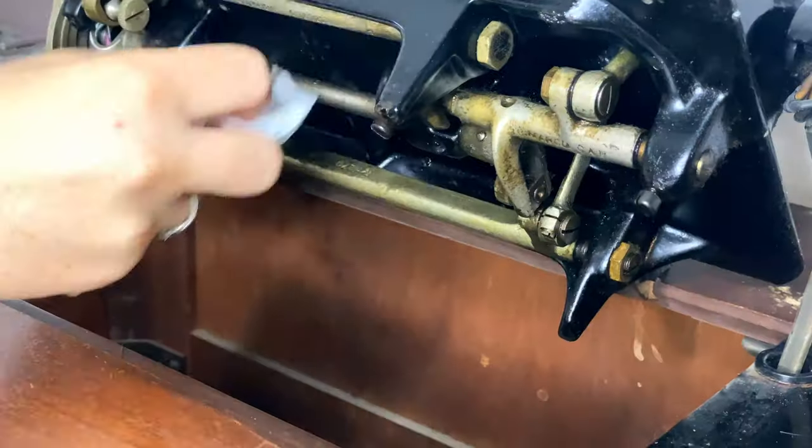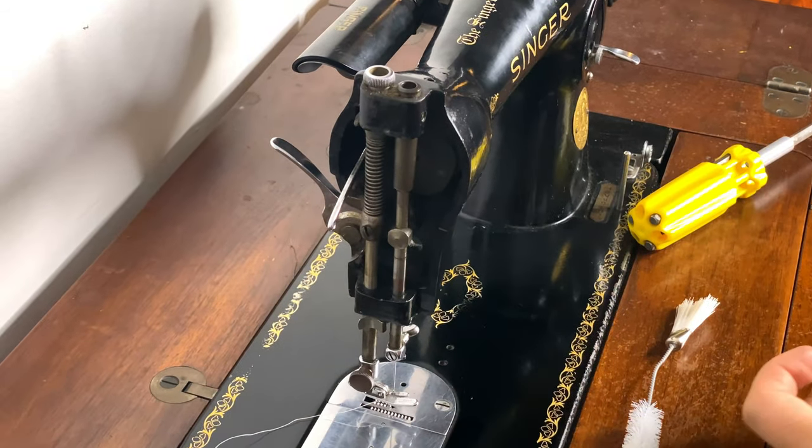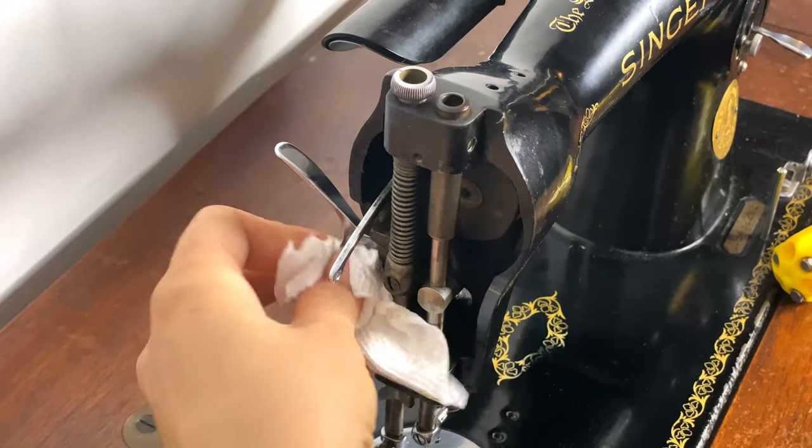Another reason why I love vintage machines is how long they last and how easy they are to take care of on your own. If you flip up a vintage sewing machine in its cabinet and look at the bottom of it, you can see how very simple these machines are — really just a few components, all made of metal. They're not easy to break and they're very easy to look at yourself, clean yourself, oil yourself, and even potentially assess a problem all on your own. Either in the bottom of the machine or if you take off the side plate on the needle side you can see the few parts in there — you can oil them, vacuum or dust in there. It's very easy to take care of on your own. Whereas you can oil modern machines too, but there are just so many more parts and most of them are not accessible, especially in the most modern computerized machines.